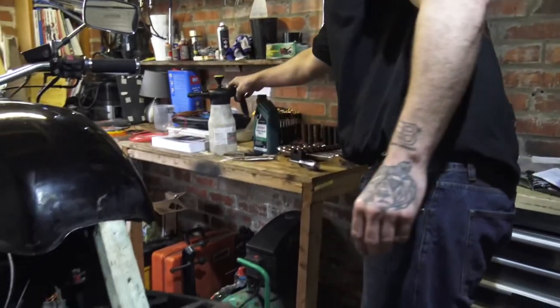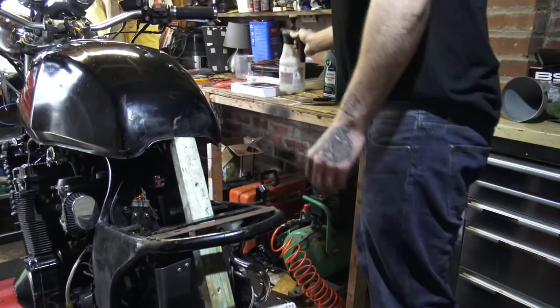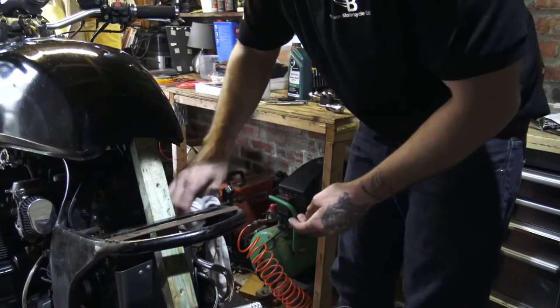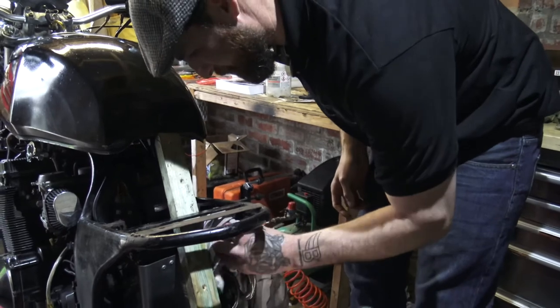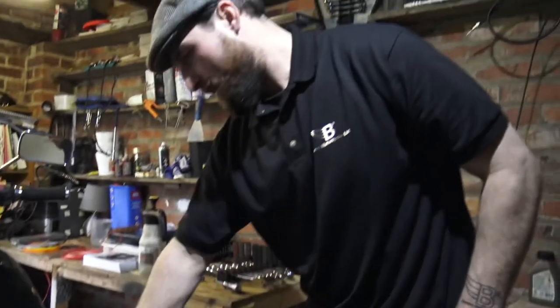You need to give it a wash down — there's brake fluid there. A little bit of brake cleaner, get your rag, wipe it all up, ensure there's no residue. You don't want it leaking onto your footpeg or onto your tyre. And that's how you bleed a rear brake on a motorcycle. You don't necessarily need a pressure bleeder or vacuum bleeders. You need a bit of patience, an old glass milk bottle, a bit of pipe, and some DOT 4 brake fluid.